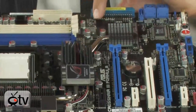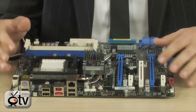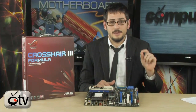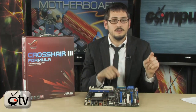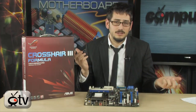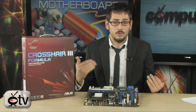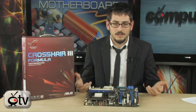All the features you're used to seeing on an ASUS AMD motherboard are here: Easy Flash, the CrashFree BIOS, Q-Connectors, and the Noise Filter. ASUS Turbo V is their overclocking utility from inside the operating system — it lets you overclock and increase the base clock and voltages without going into the BIOS. My method is to run Prime95, then use Turbo V to click up the base clock and voltages quickly, test Prime95, and when a thread dies you know you're at the border of stability. Then back off, increase voltages, and keep going. It's a quick way to overclock without the cycle of saving BIOS settings, rebooting, and testing manually.